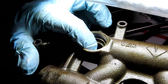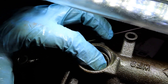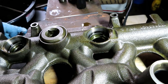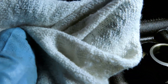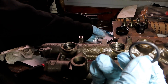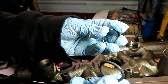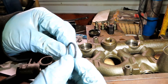I'm going to clean this up a little bit before I put the new seal in. I'll oil the new seal and put it in, but let me get out all the cups first. All the seals are out - two of them were so hard they could have possibly broke my pick, so they're definitely not sealing that well. I'm using a brand new clean rag to clean the inside where the seals go. You can see the original seal is super hard, so it's not sealing that well at all - that's why the cups were so loose.